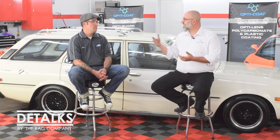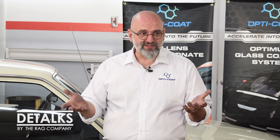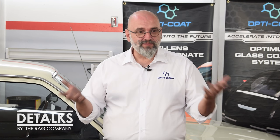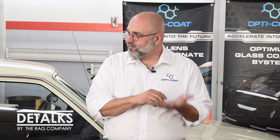It's a carryover from the way it used to be done. A lot of the compounds on the market now and the optimum polishes, if you're using a rotary, we want to use it between 600 and 1,000 RPM. Really low speed, because the less heat you create, the more it cuts. Think of an ice cube and a marshmallow. That's the best analogy I have. And a piece of sandpaper. If you take your ice cube and rub the sandpaper over it, it's going to cut the ice cube. Take a marshmallow, run the sandpaper over it. It gets gooey. That's what's happening with your paint.